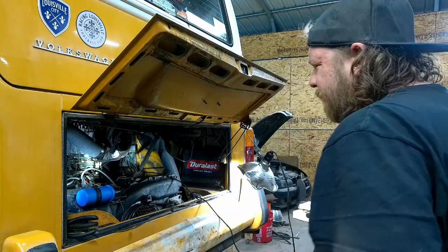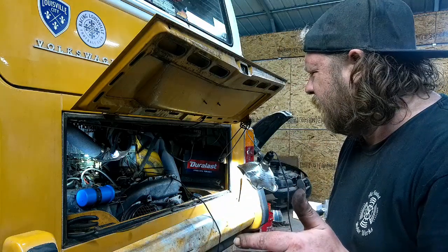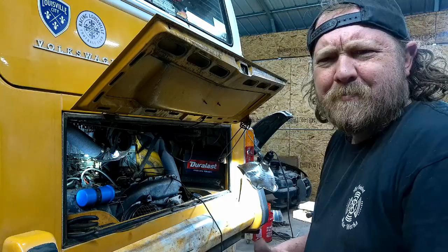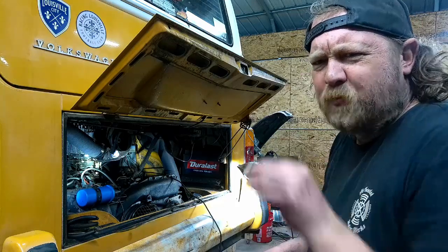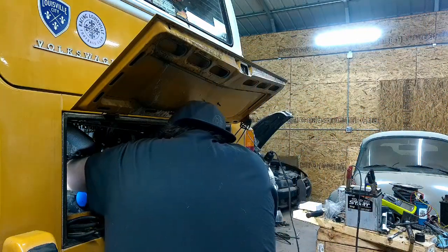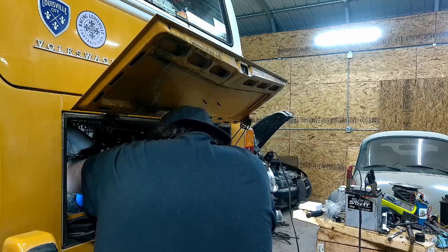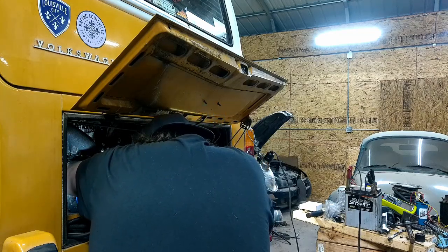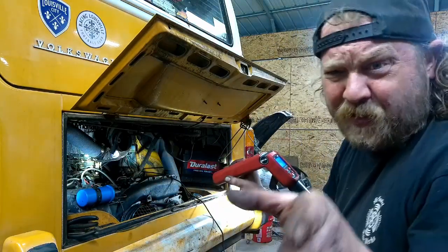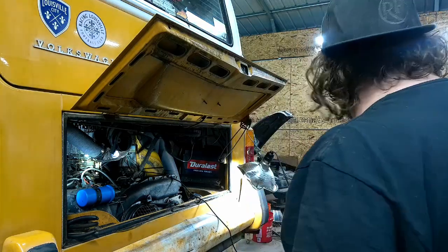All right, put that down. See what our final advance curve is. I'm hoping we got 28. Like I said, I'm going for 32, but we should be at least 28 right now. You wouldn't believe it, but it's 28 or 32 on the money. So I'm gonna call that good and cinch this thing down.